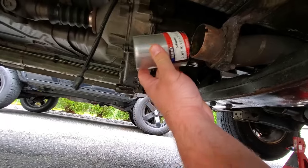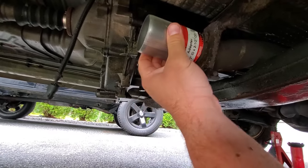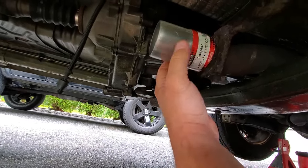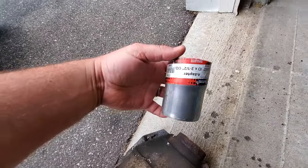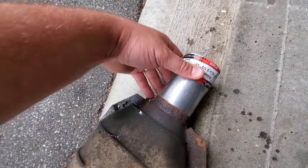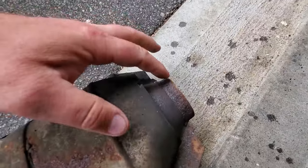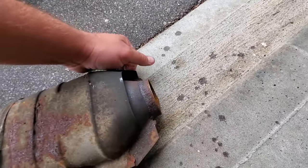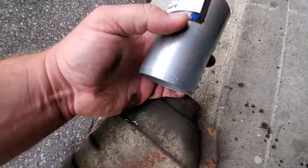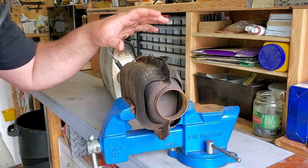The first piece I'm gonna be working with is a two-and-a-half inch outer diameter adapter. This slides right on here, so I'm gonna try to force this end into here. It looks like it was welded in when they originally installed this, so it's close enough. I'm just gonna grind up the inside, clean it up, then weld on this piece first.